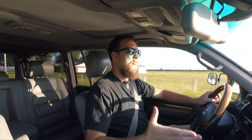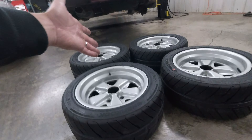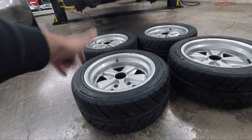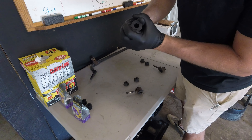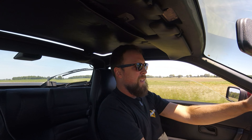It's only the second time we've put this car to the test. The first time things went well — it drove all 16 runs between myself and my brother Mitchell — but it was not the most competitive. We did a couple major things to the car to hopefully bring it up to snuff. The main one was tires — brand new Hankook Ventus RS4 tires that are fairly sticky and right at the minimum tread wear level allowed in street class. We also changed the front sway bar bushings to make them much stiffer, which the car needed terribly — it rolled so badly in the corners. Now between those two items it is a completely different animal and handles so much better.